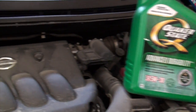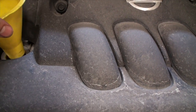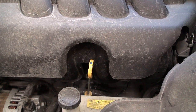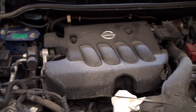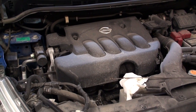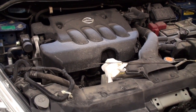To fill the engine oil, open up the oil fill cap on the crankcase and using a funnel fill it with just over three and a half liters of oil. Once you put in about three and a half to three and three-quarters liters, check the oil level with the dipstick to make sure it's filled properly. I'm using a standard conventional non-synthetic 5W30 engine oil by Quaker State. I've finished filling with about 3.8 liters, replaced and tightened the oil cap, and made sure the engine was on level ground before checking the oil.